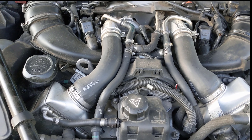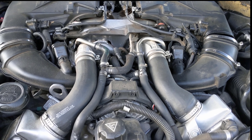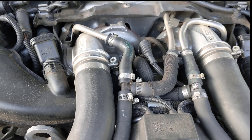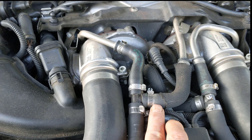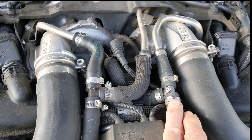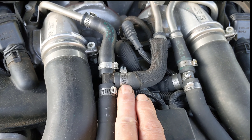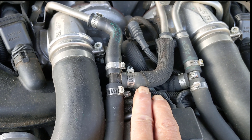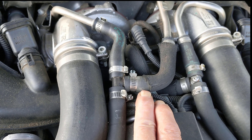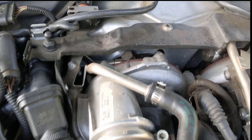Welcome to another video. In this video we're going to be replacing the turbo coolant lines — they leak, and if you've read anything about them, you know they leak. This one has been repaired, and what you have to look for after a repair is that the hoses will start ballooning after the clamps — getting bigger, expanding — and that's when it becomes dangerous. First they'll get bigger, then one day they'll just bust.